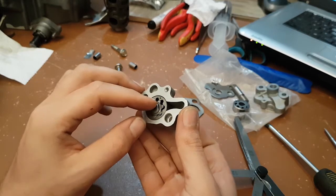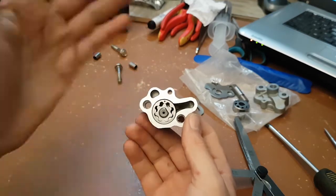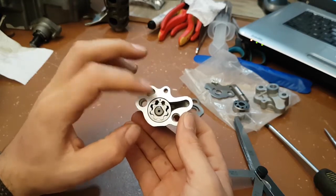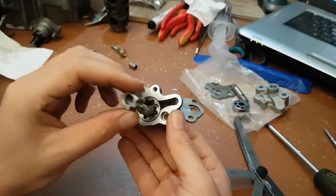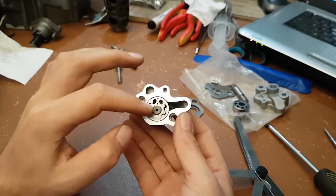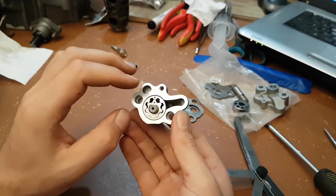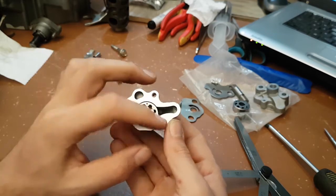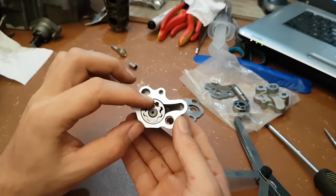With time, these marks and scars are matching each other. So what happens if, after thousands of miles, you realize you put your new oil pump in a certain way and then decide to match the dots the 'right' way? If you do this, you will actually add more scars, because you will change the matching surfaces of the already damaged parts, creating even more damage.